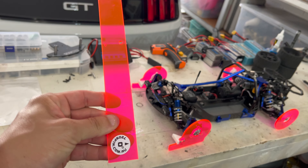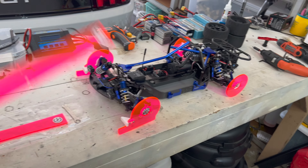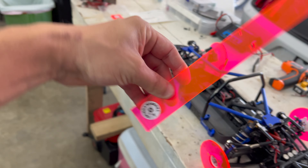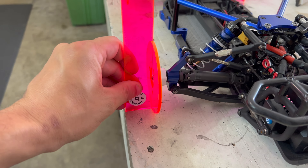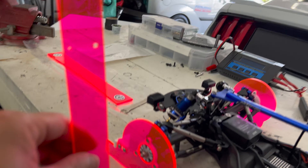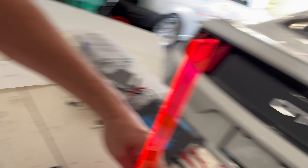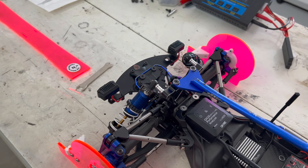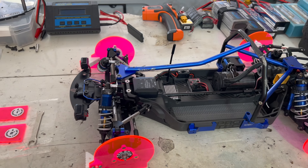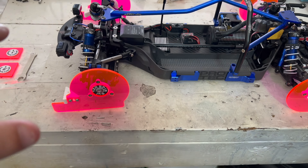I also use this tool on the negative side to set camber. The backs are done; the fronts I'm still working on. Take the zero degree, put it up against the car — see, it is set at zero, which is awesome, that side is done. The fronts are not. I have a little camber in, and I think this side has a little more camber. It's almost there. Still working on this because I got the traction bars — it's a little more complicated, but it's going to get there.